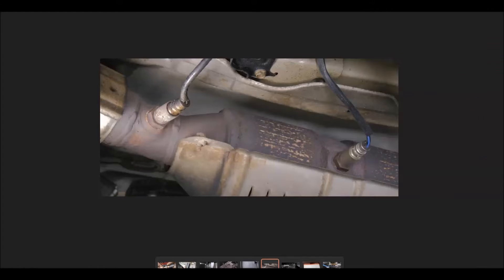There are going to be two oxygen sensors on each bank of the exhaust. On many Hondas they just have two total, but with this code it's pointing to four O2 sensors in total. When an oxygen sensor is before the catalytic converter, it's called the upstream or sensor one. When it's after the catalytic converter, it's called the downstream or sensor two.